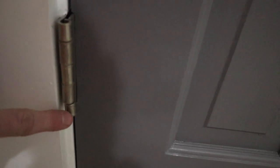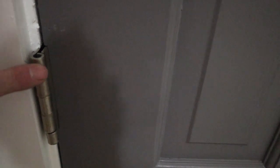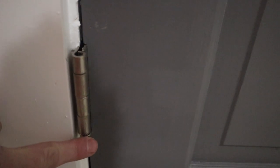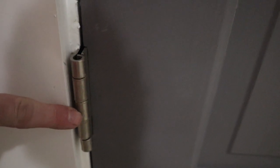And you can see when I pulled the pin out, the door kind of settled in a little bit, which makes it where it'll open and close easy over here now, and it's not hung anymore. If I pull this odd one out here on 5, pull it back up to match 2 and 4, so this is a straight line, instead of seeing how it's kind of kicked out right there, that's what's binding the door. So if I use the knuckle bender and just pull this in a little bit and put the pin back in, that should fix the door where it'll open and close easy.